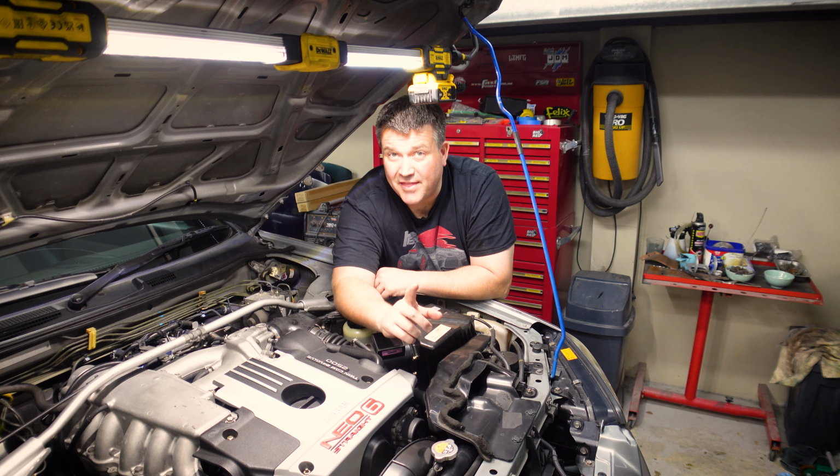But if we do, I do have an external pump, and then what you'll see me do is pump out 2 litres, and each time I get to a 2 litre mark on this, I'm going to try and pull 2 litres out from here. We don't have to get it perfect. We just have to make sure that we don't starve the transmission. And then once we're done, we're going to make sure that we fill and top off according to the dipstick